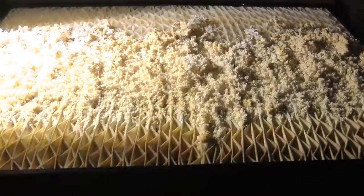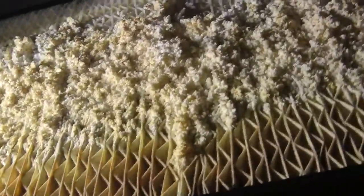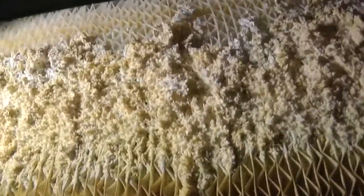It's calcium's plus 2 charge, and it's suspended in the water. So if you want the calcium to come out of suspension, you're going to have to give it what it craves, which is the 2 electrons. And that's what the current, basically, that passes through the wick is for. It gives it 2 electrons, which precipitates it out as the aragonite crystals, and coincidentally, the 2 electrons also give the OH groups what they need to form water again.